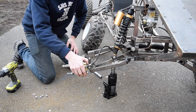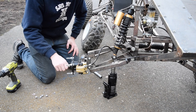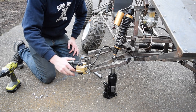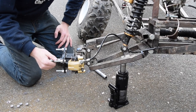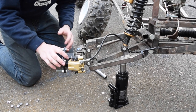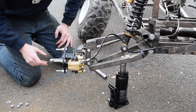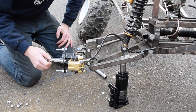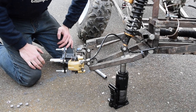These are off of a 150cc go-kart — they happen to fit perfectly on here. They slide right over your existing 5/8 inch front spindle. I added a 5/8 inch tubing over the intersection here because the inside bearing is slightly larger than the outside. Then just another piece on the end, and I drilled a hole in the end of the spindle and tapped it for a 5/16 inch bolt. I'd like that to be bigger but because of the size of the spindle that wasn't really an option.